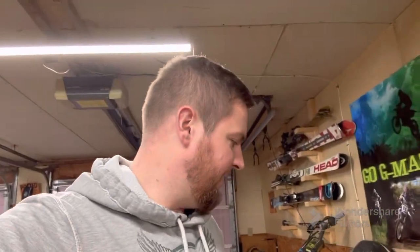So I got really excited because I know I have a set of spare pistons that came with this car that I presumed were out of the original motor, because this one originally had a timing belt break and smash all the valves, and they sourced this other motor, which is an 85 to 86 M44-7 engine, is the serial code on this. So I was like, oh, I've got these other pistons. I'm looking for tolerance group 1. I go out to the shed, scrape the stuff off, and I'm like, oh yeah, tolerance group 1 piston. It's not in bad shape.